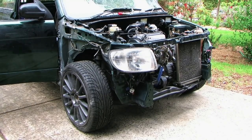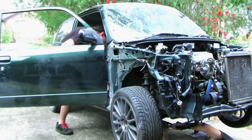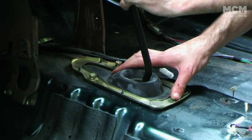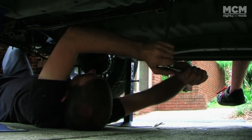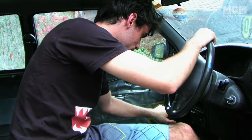With our clutch cable now installed and working, we were able to select gears and move the car without lifting it. The next step was getting the manual shifter in, which luckily bolts up in the exact same hole as the auto we just threw in the bin. After some aligning and the odd swear word, it was all in and working.